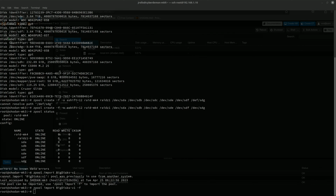But I'm kind of okay with that because a lot of my other VMs aren't that RAM heavy. If I start adding more VMs and I need more RAM, I'm totally okay with limiting the performance. But as it is right now, I'm going to be sitting at exactly the right amount anyway without having to do any config changes. So we're not going to worry about that. You also want to make sure your swap space and other things are set up on different drives, and there's cache that you can set up and all that.